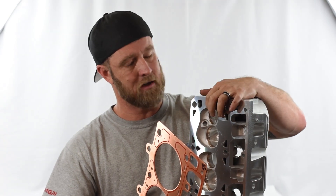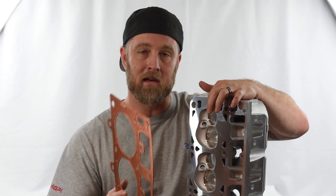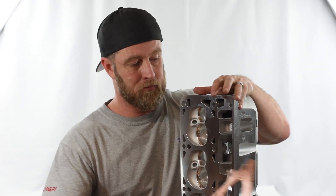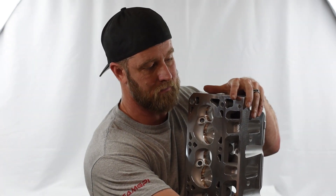We've seen cars come in here in the past — for example, I had an LS7 that came in a couple of years ago. This had detonation like crazy on a naturally aspirated setup. We finally figured out the head gasket that was used was too small for the head chamber and the bore on that situation. You had head gasket hanging over inside there and it created a hotspot that created numerous tuning issues. You couldn't take enough timing away from this thing to keep it from detonating.